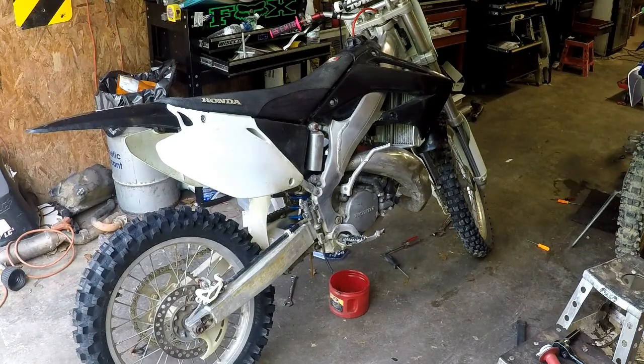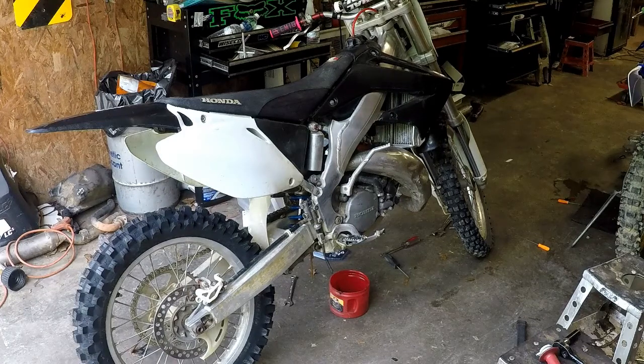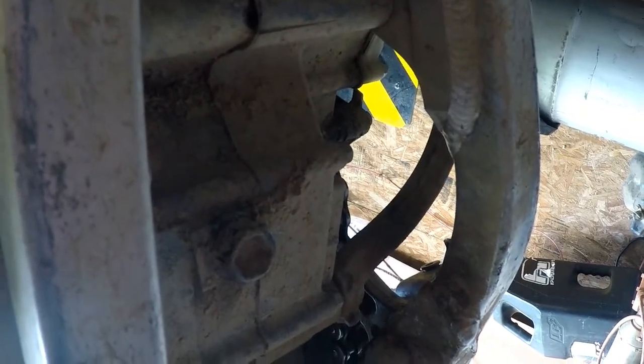This is a simple, straightforward video on how to change the transmission oil on your CR125. This is an '03 CR125 — they're pretty much exactly the same from '02 to '04 — and you change the transmission oil the same way on basically every model ever made. We're going to start off by draining the old oil. It may help if you start it up first to get it warm and thin out that oil a little bit so you drain more out.